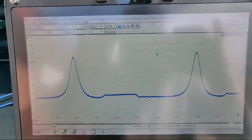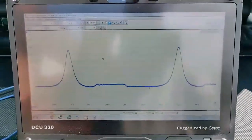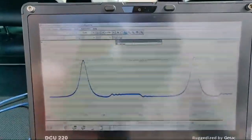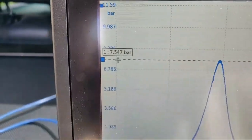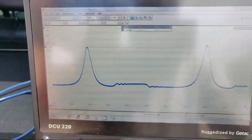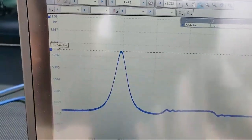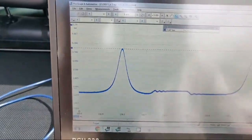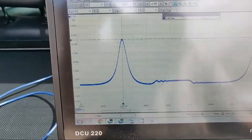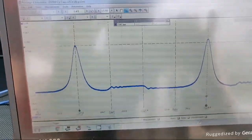This is the scope trace from the last video of the old cylinder two. Just to recap - that's the old cylinder two compression pressure, about 7.5 bar at idle. That was the old compression pressure, seven and a half bar. Now we're just looking very simply - drag some rulers across here from the bottom.